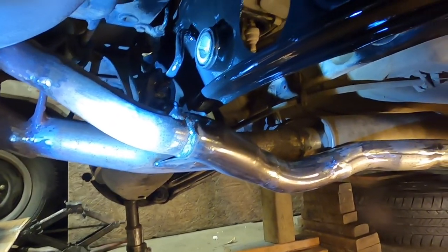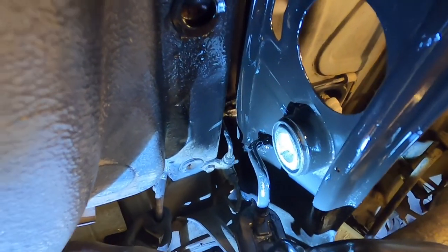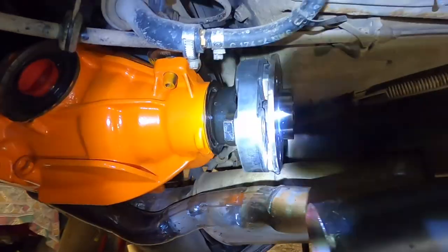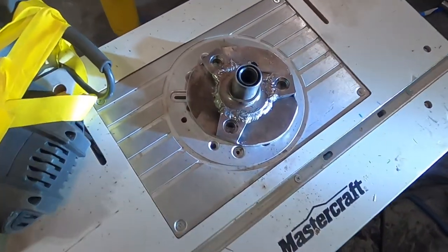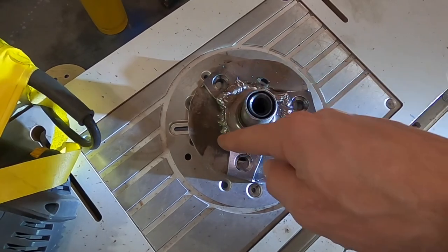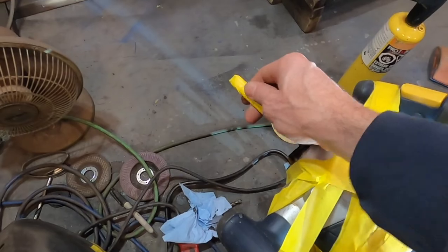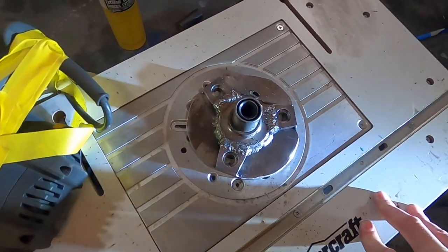I'm going to call it a day here — it's working on midnight, but you can see I got the boot out there now and the new exhaust piece is in. It's kind of looking like I nailed it first try. I just want to do a progress update as I finish up the solid welding. I want to solid-weld everything around here before I cut out these areas, and I've been running the vibrator — which is just a router with a drill bit and another drill bit taped to it just to make the table vibrate — and that's supposed to stress-relieve the metal.